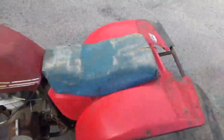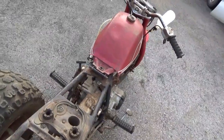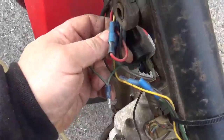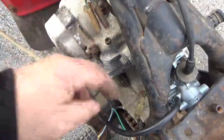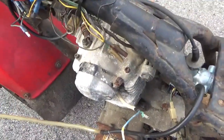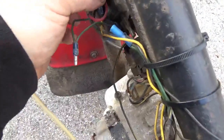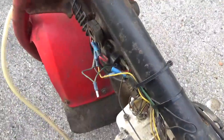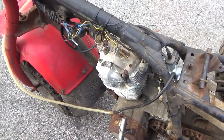So where do we start? First of all, unlock it, get the plastic off, get the gas tank off, and you can see everything you need to see. You can see there's been some redneck creativity to the wire harness here, so I've got to spend a few minutes fixing that. I unplugged the pulse generator to make sure it goes. I would start out always trying to get things hooked up again the best you can, because normally by doing that you can see what works and what doesn't.